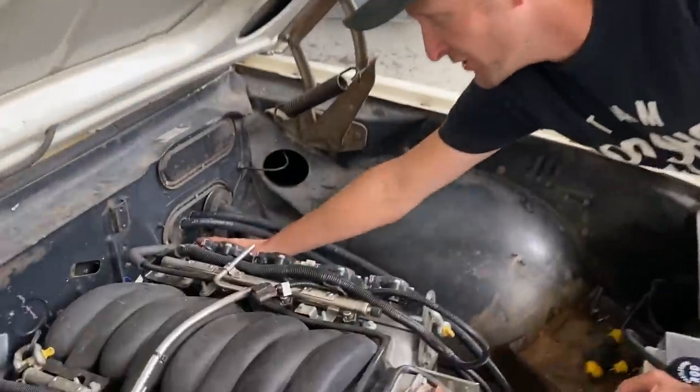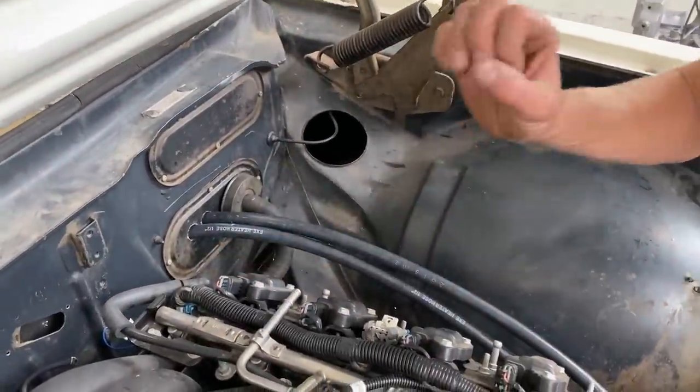Wiring time now — I've got to get the thermo fans sorted. In the floor, Jake has laid a couple of coils of wire — one's coiled up with two twins for thermo fan one and thermo fan two. All I need to do is drill a hole down underneath the radiator hoses, put a rubber grommet in, and feed the two wires out. Very simple — they're labelled one and two. Doesn't matter which way around you get it, join them up together, cut them, solder them, and then we can move on to the fuel system.